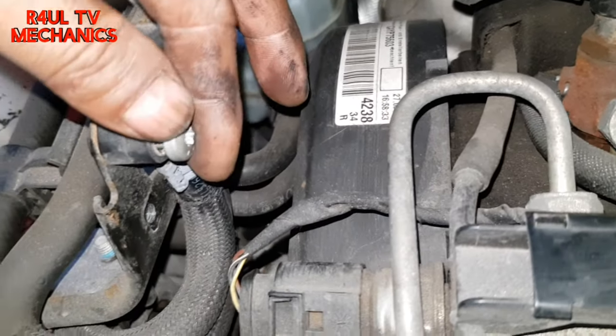My bad, I forgot to mention this — we need to take this off as well. This Torx 30, we'll take that off and hopefully we can get that pipe off. Try not dropping the bolt. Okay, that comes off, and that one should come off as well. It's on a clip there, so we push the clip up like that and that should come out. You need two hands — two hands will be a lot better. My man Gary took the camera off me. So we've got that off. Let's get a flat screwdriver in there — that comes off. Now we can go ahead and take that pipe off.